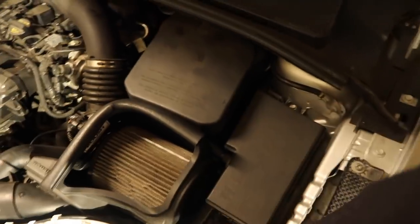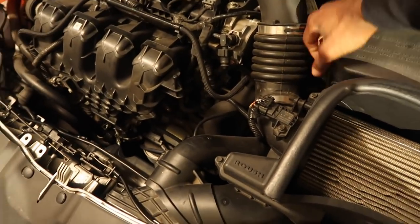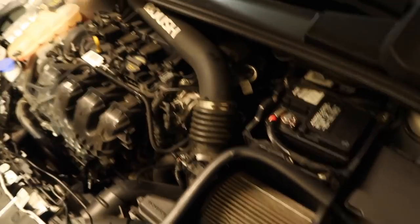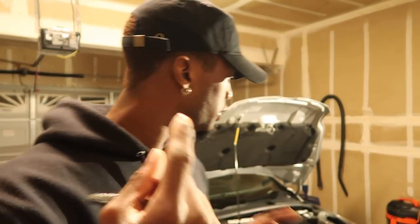For safety we're going to unplug the battery so there's no power in the vehicle. You can just remove the negative terminal with a 10mm — that comes right off. Once that's done, then we'll go in and get started. So we just unplugged the battery. What we're going to do now is take off the intake — it's going to be an 8mm — to get access to the fuel rail, which will also make it easier to install the whole system.